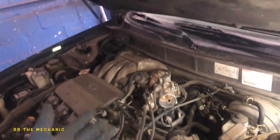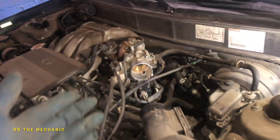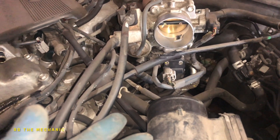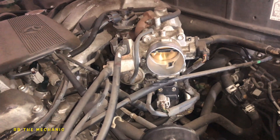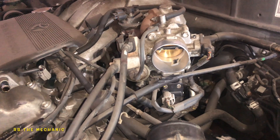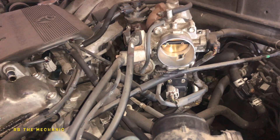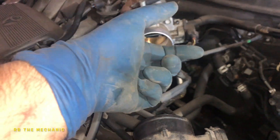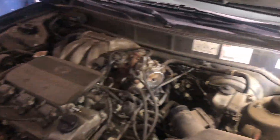Most cars — if you mess with the throttle body and you don't do it the proper way, you're gonna cause damage. I do have videos on that. Some cars might pop a check engine light, like Hondas — it's common when cleaning the throttle body, but it will relearn its idle speed. All you have to do is reset it by hooking up a scan tool. Nissans — same thing. On Nissans I like to just disconnect the battery so it picks up right where it left off. Sometimes I like to disconnect the throttle body connector on an electric throttle body while the engine is running so the speed goes down and it goes right back on. Lots of procedures. Anyway, thank you for watching.